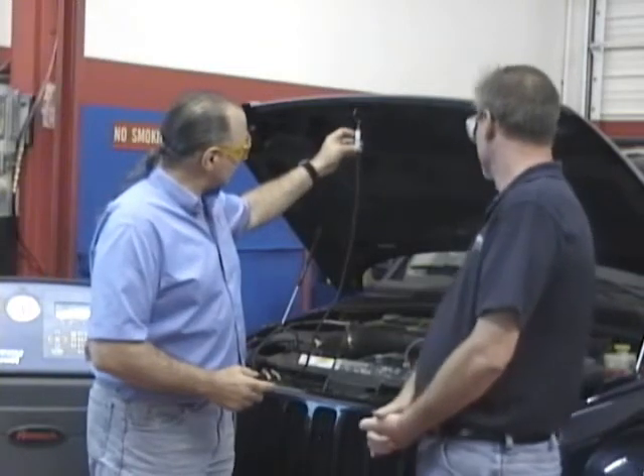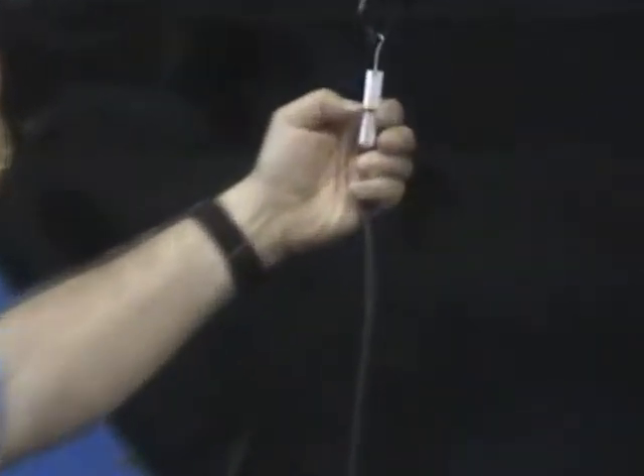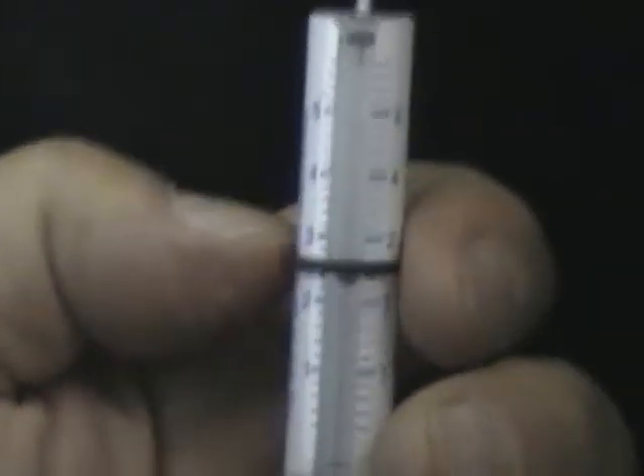Now let me talk about a real story here. You can see Craig is zoned in - we see the ball floating. We put this little band here so we know where it starts from. If there is sealant, the refrigerant and oil are going to come out of the high-side port that we're connected to, go through a small cartridge that's a flow restrictor, and that cartridge is going to get clogged up with sealant. When the ball falls 40% or so in less than three minutes, that means something has clogged up the restrictor - you've got sealant.